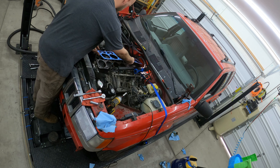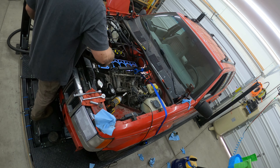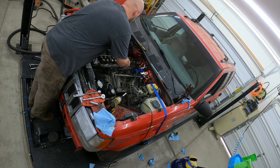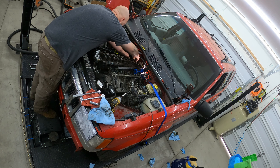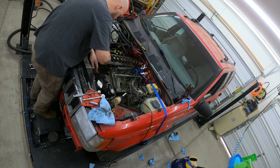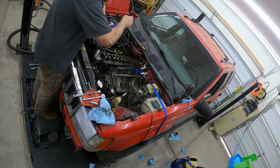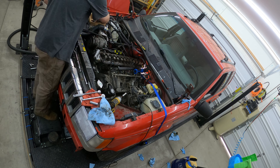New gasket's going to go on — pretty hard to mess this up, it only fits one way. I make this look pretty easy but it did not feel easy; that thing is heavy. I did not use any RTV on the head gasket, it's just there as is. I'll link the gasket kit I used below. Now for these bolts — I'm going to put one in each corner dry first, just to make sure the gasket is in place and doesn't move. Something to note: when you put these bolts in, the specs say wet torque. That means use engine oil on the threads — not Loctite. Just put some oil on the threads when you torque them down.